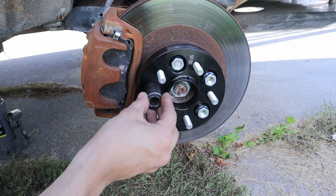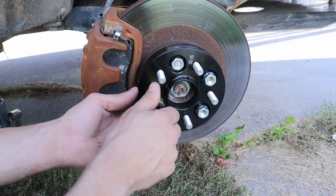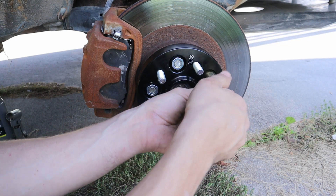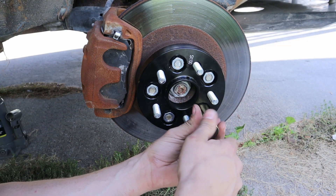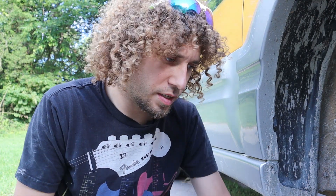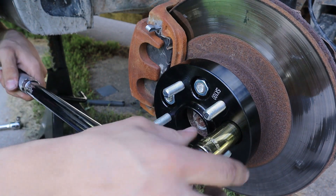This 19mm impact socket won't fit — just giving you guys a heads up that some of your tools might not fit, but these are 19mm. Which is perfect because the instructions say not to use an impact to put these on. They say go off of the manufacturer's specs when torquing your wheel spacers. From the factory, Subaru says 70 to 80 foot-pounds on the lug nuts. So let's do that — do a couple turns on each one before we go in for the final torque settings.